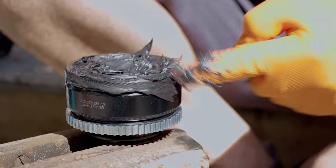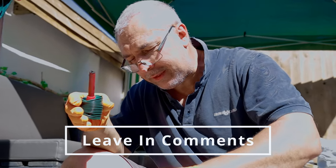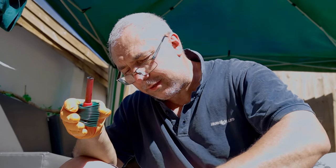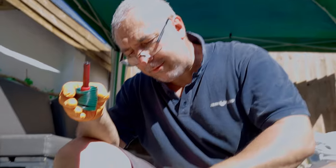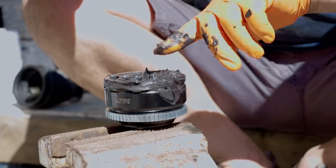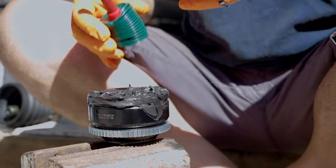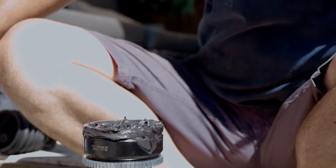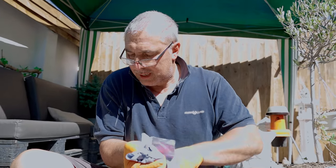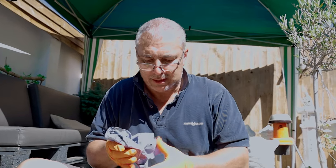It's a talked-about topic, how to pack your bearings. I'm probably going to get loads of comments saying I've done that wrong and should have done it this way — and you may be right — but it hasn't let me down before, so we'll see. Feel free to comment if you wish. So that's how I pack the bearings. There's still some grease left which I'm going to put inside the boot once I put the boot back on — about just over half gone into the bearing, which is good. I'm going to clean this up a little bit and then get ready to put the shaft back on.